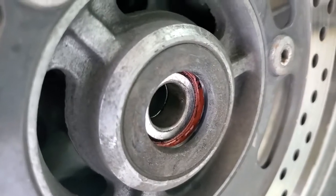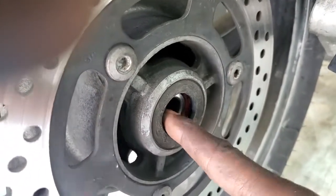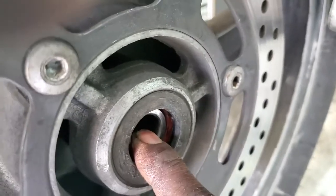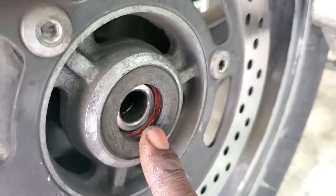You can see there's a pretty orange cover in there. To test a wheel bearing, you want to put your finger inside this hole and turn the actual bearing surface itself. You want to feel for any inconsistencies, any roughness — if it's rough then chances are the bearing is bad, and if it's smooth then the bearing is good.